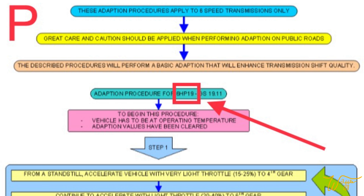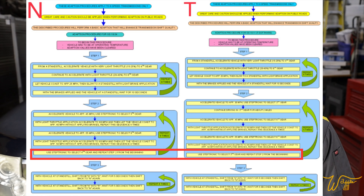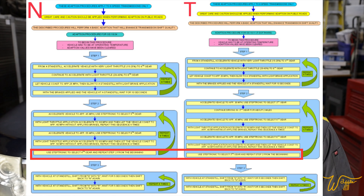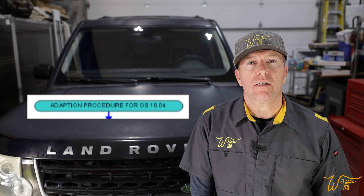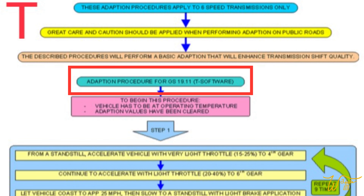Procedure A seems to be the most basic with just one step that you repeat nine times. I was going to go with that procedure because every other one talks about using a Steptronic to manually shift the gears. The LR3 does not have a Steptronic, so I thought that must be the one. However, upon closer inspection of our transmission gear shifter and reading the manuals, there is a very similar selector that Land Rover calls Command Shift. And procedure P is for the 6HP19 transmission, which we don't have, so that one is canceled out too, leaving N and T.